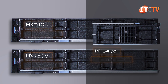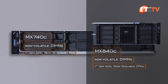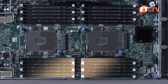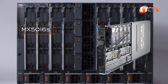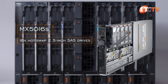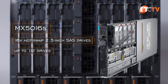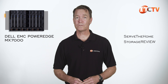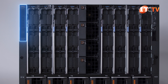There are currently only four modules supported on this system. Two single-width compute modules: the six-bay dual-socket MX740C with support for Intel Xeon Scalable Processors from Gen 1 and Gen 2, and the MX750C, also six-bay, but with support for third-generation Intel Xeon Scalable Processors. There's also a double-width quad-socket server sled, the eight-bay MX840C. Both the MX740C and MX750C can provide almost eight terabytes of memory at capacity, while the MX840C can deliver a little over 15 terabytes. All can be outfitted with persistent memory modules, but only the MX840C and MX740C can host non-volatile DIMMs, and only with first-generation Intel Xeon Scalable CPUs.